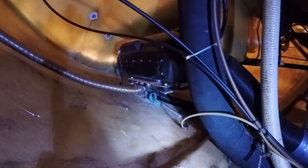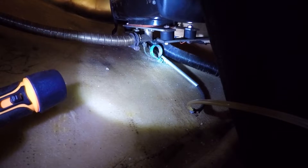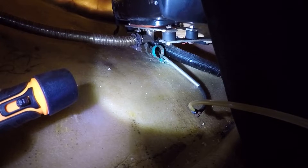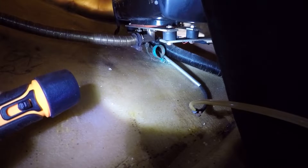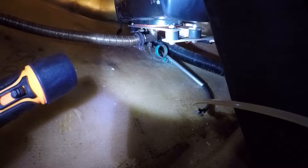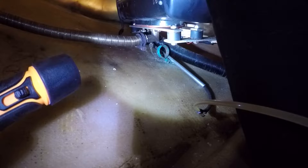On this heater you'll notice it's got rubber mounts to isolate noise from the hull. The other important thing to look at is the water trap. At the bottom of the heater there's a right-angle bend coming out of the exhaust with a water trap — three coils of copper — which is very important to collect condensation and act as a vapor stop for the exhaust gas. It's very important to have a drain at the lowest point because you get condensation and you don't want it going back into the heater. On a motorhome or caravan you'd just drill a hole at the lowest point in the exhaust pipe, but you can't do that on a boat or you'd get exhaust gases inside.